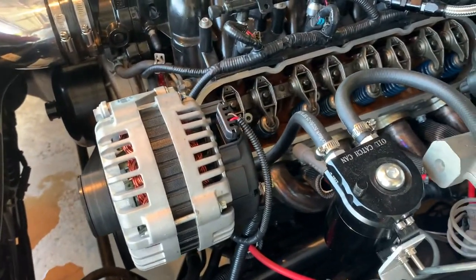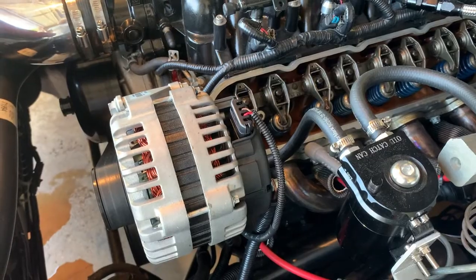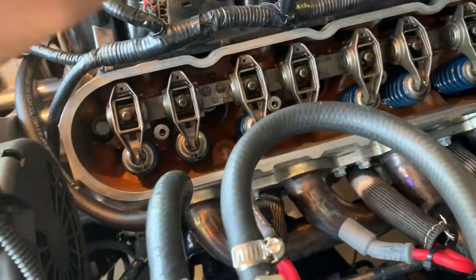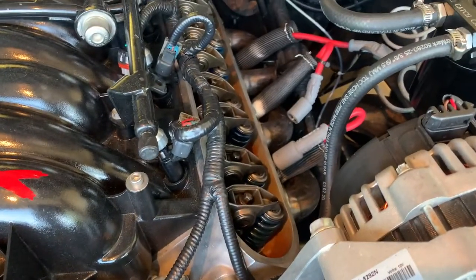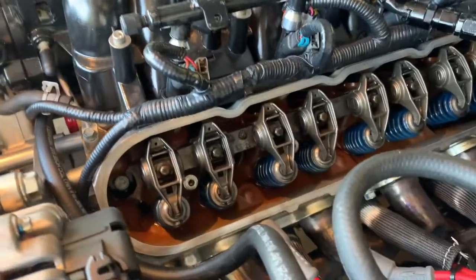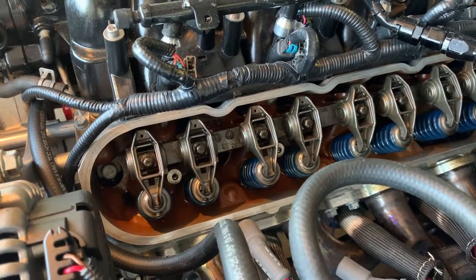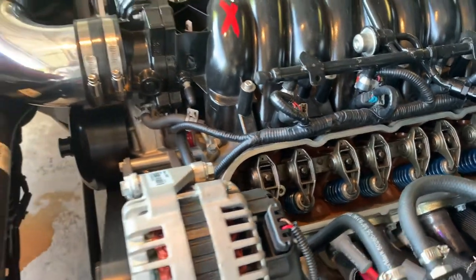I was hoping I didn't have a cracked block. I'm confident I don't. I thought I had some bad head gaskets, but I'm very happy and fortunate to know it's just on the top end — it's an ugly painted head. You'll sometimes see a clean or shiny spot where the coolant seeps out through the heat cycle. That shining area is the telltale sign, which is how I spotted it from watching another mechanic's video.